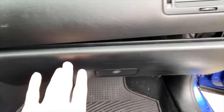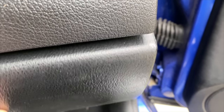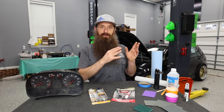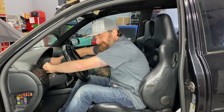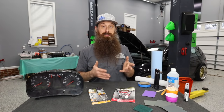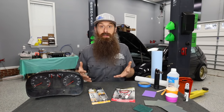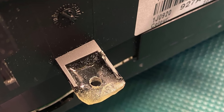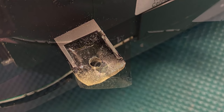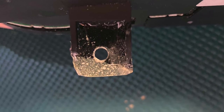What's going on everybody, it's Charles. Today I'm going to show you how to mend and repair broken vehicle plastic. This all came about when I was taking the instrument cluster out of the Black R32 and found that one of the securing tabs was broken. Rather than leaving it or replacing the entire back plastic housing, I wanted to go ahead and repair it. I used some masking tape and epoxy and essentially made a new securing tab, and since that worked so well, I wanted to share with you guys exactly how I did it.